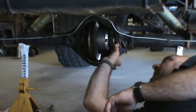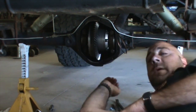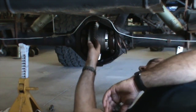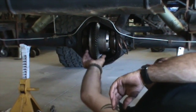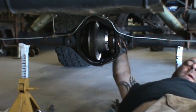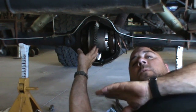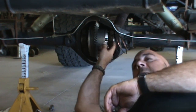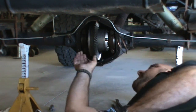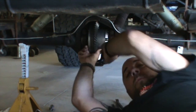Now we've got everything in there — we've got the shims in both sides and the bearing caps on. We've got a pretty good initial backlash, so what we'll do now is paint some of these gears, spin the driveline, and see how things line up on the drive as well as the coast side. We'll need to pull everything back out — we have some O-rings in here for the airline to actuate the lockers — but for the first setup it's feeling pretty good.